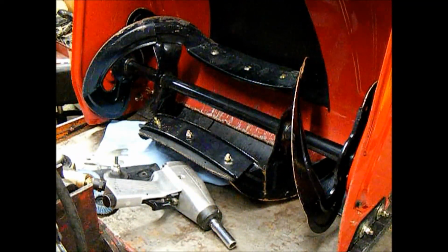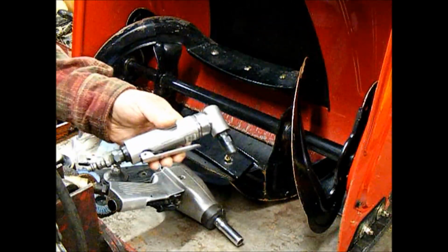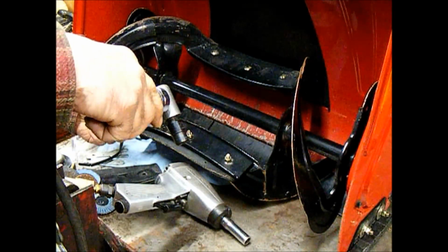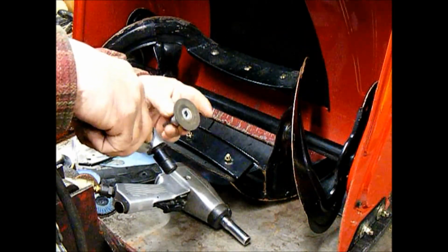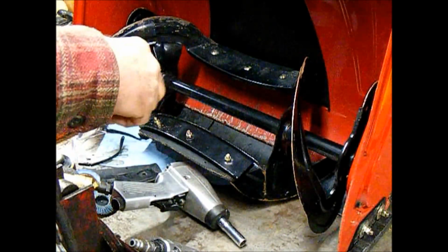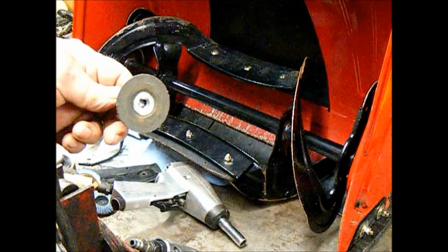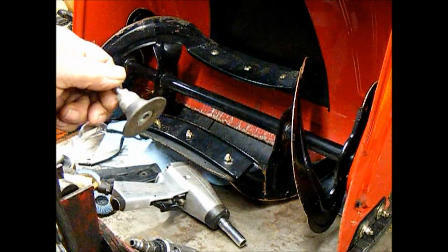Okay, so for deburring these augers, I'm going to be using a 90 degree air operated die grinder and a Roloc sanding disc. For those of you who aren't familiar with Roloc, some people call them a cookie wheel, some call them a Roloc disc. Roloc, I'm pretty sure, is a 3M company. They're not a sponsor. They're just something I've always used.